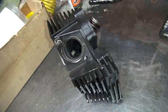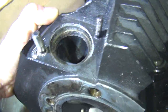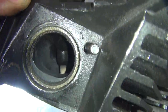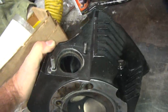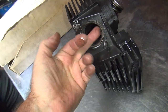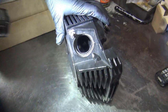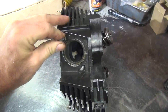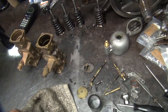Right here — you got a leaky head. Before I clean it I don't know which one it is, but you can see the trail of oil coming out. Coming from the outside of the guide on the OD. Yeah, the valve is dry — if I see it, it's from the outside of the guide. Probably nice burnt oil too, I'm sure. It's clean, it doesn't seem to be all that wet. It's wet, but it's not burnt wet — it's fresh. It uses so much oil it's not even burning, it's just pouring out of there. That means it's a big oil leak on the guide — we're going to pop the valve out and see what's going on. All right, project number three. We'll get back to our carburetor in a minute.